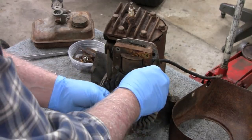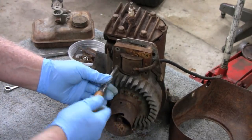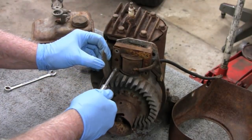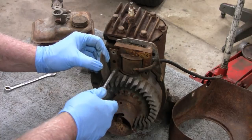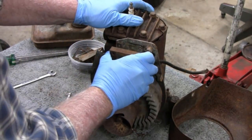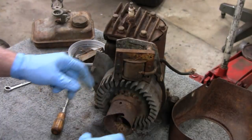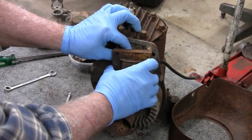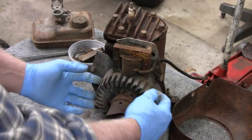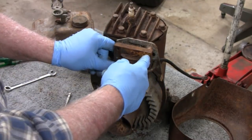I'm old - I'm only allowed to forget. I just got done working on newer stuff, it fooled me. This has a wire here that connects to the points so I won't be able to get that off until I remove that. I might as well just put a couple bolts in there to hold it in place.